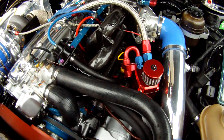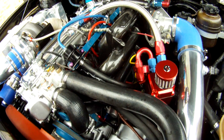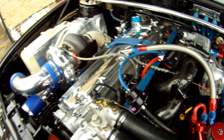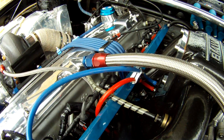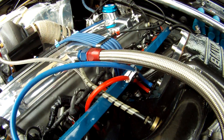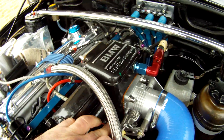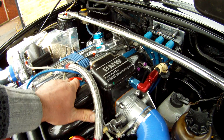The alternator bracket is still the same original. Had no luck with the bushes but I still have to change the bracket over to the E34 setup — at a later stage, obviously wanted to get it running and tested first. I've blanked the pipe that comes out of the centre of the manifold and blanked the plug inside the pipe. Shortened the accelerator cable to make it nice and neat — still not quite there, something else to sort out in the future.